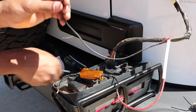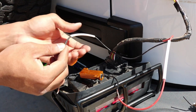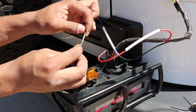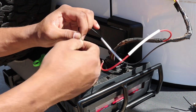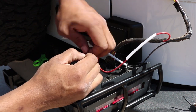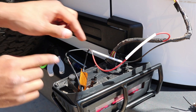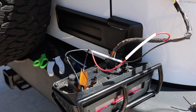I'll show you how I solder wires together. Instead of using a butt connector I like to solder — it's more permanent, more reliable, and just better. Put the heat shrink on first — it's easy to forget that. Then you want to kind of overlap and tail-connect your wires, twist each side, and lock each wire into place. Then wait for the soldering iron to heat up and solder the wires together, then slide the heat shrink over, heat it up, and you're done.